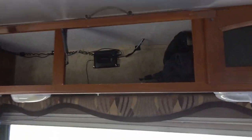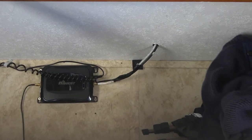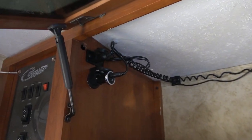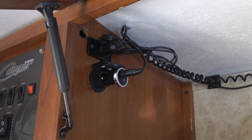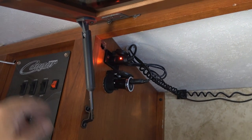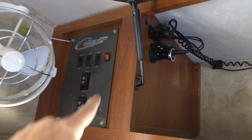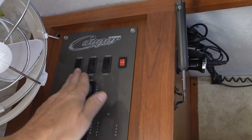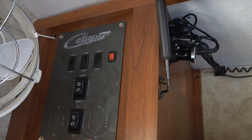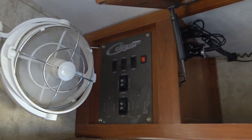The 12-volt power comes down from the roof through a junction box — that's where my cell booster is too. They both connect to 12-volt outlets: one for the cell booster and one for the camera. I have a switch so when I'm getting ready to tow I just flip it on. I was also able to find 12 volts at the Cougar's switching panel that controls lights and the ceiling fan — lots of wires back there, plus a 12-volt fan. So that's how it's done.